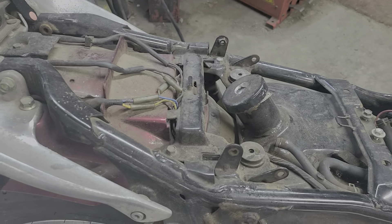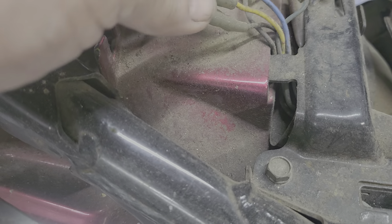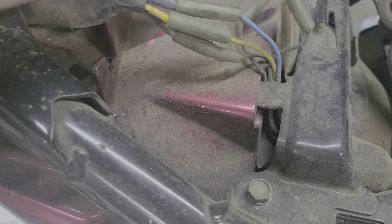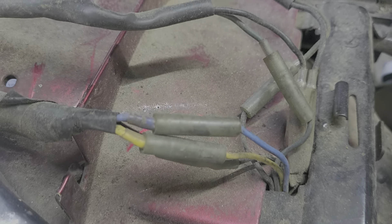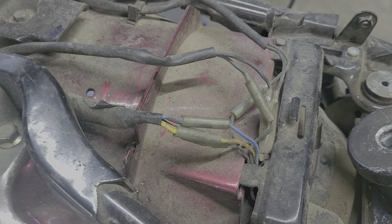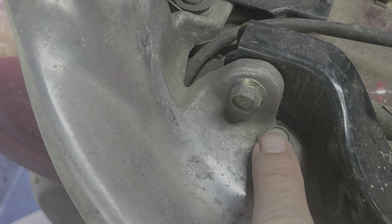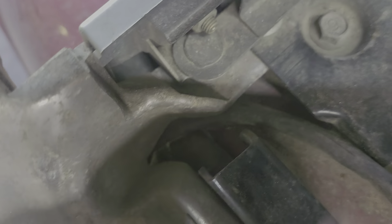And the back fender — you've got your little rubber mount that comes in here, and you've got these five wires. They're all color-coded so you can't really do anything wrong when you're hooking them back up. Besides that, you have a bolt right here on both sides with a 12-millimeter head.